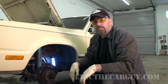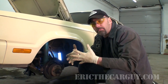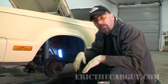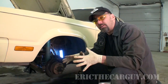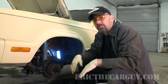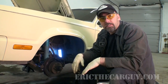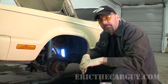It's not going to take that long to do this, but we want to work quickly, and one of the reasons is because, as you've seen me work in other videos where I'm doing hydraulic work on brakes, you've seen me crimp off the rubber brake line. Well, since we're replacing the rubber brake line, we don't have that option. So in order to avoid bleeding out the entire master cylinder, we're going to first top up the master cylinder and make sure it's as filled as it possibly can be. But in addition to that, we're also going to work quickly so that we don't have to worry about losing a bunch of brake fluid while we do the job. So why don't we start with that? Let's start with checking the master cylinder, making sure it's filled up, and then we'll come back down here and get into things.